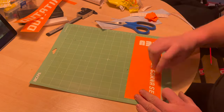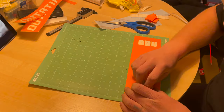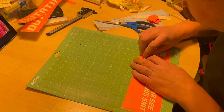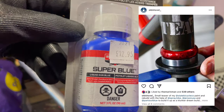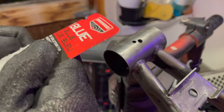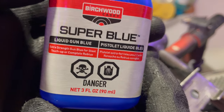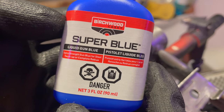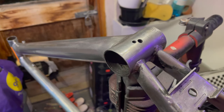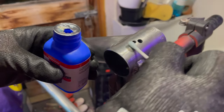For the logos and decals, I made some stencils for the bluing using my Cricut. I reverse-peeled them, pulling out the innards instead of the outers, which felt really unnatural. I've mentioned bluing a few times — if you've seen any old shovel videos you'll have seen this stuff. A lot of people in America use it to touch up guns, but it essentially reacts with steel and changes the color to a bluey-black — hence 'bluing.' I wanted to test it first.